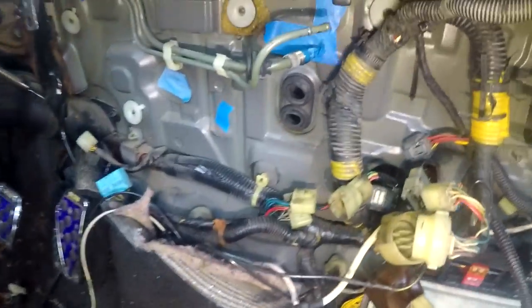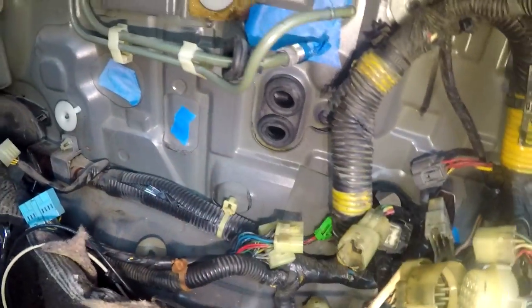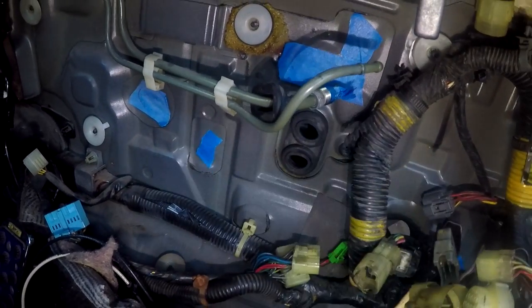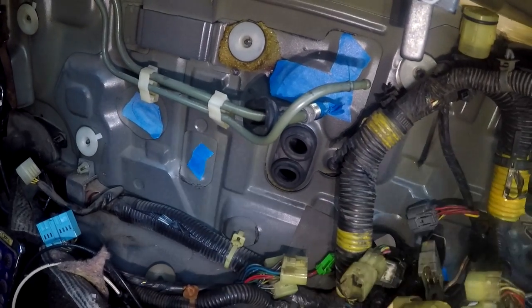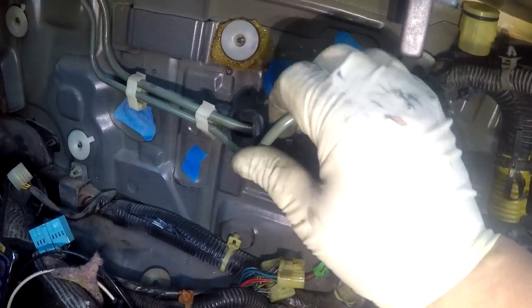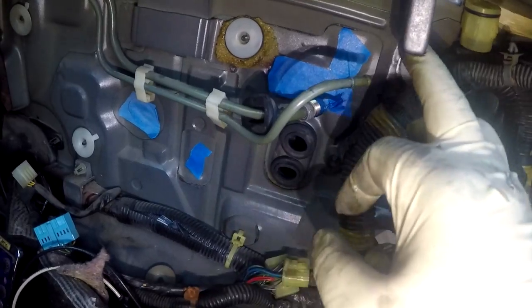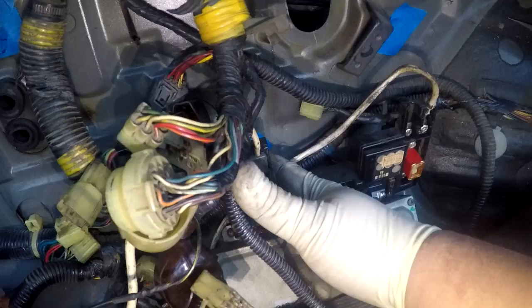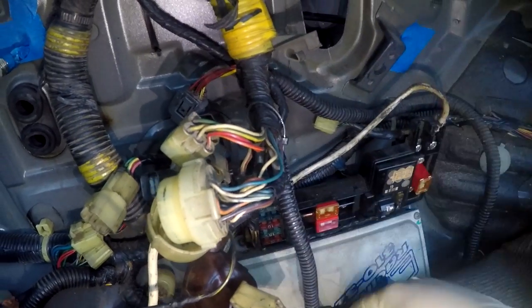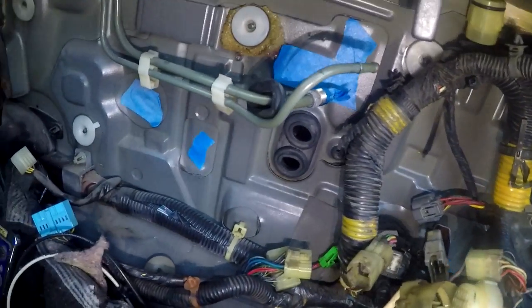Inside the car here, got my grommet put on right there. So like I said, this guy right here is the fuel tank ventilation, which then went to the canister, which I am not running anymore. Probably just gonna bend it nice and flush against the wall, put a hose on it, and exit it out through the AC hole, so that way the tank ventilation goes out under the car instead of in the car.